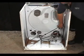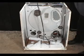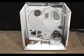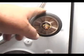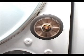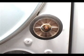Remove the belt and the idle pulley. Now you could check and replace the drum support rollers. Most people don't realize that the rollers need to be replaced until they're in bad shape like this, and the dryer sounds like it's running on a flat tire.